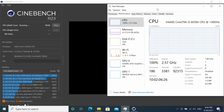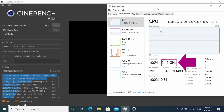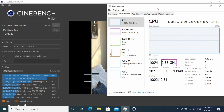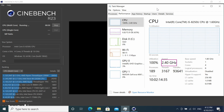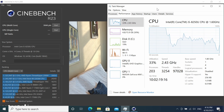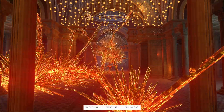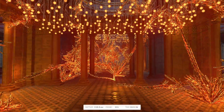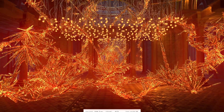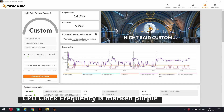Now, let's see how quickly my CPU can render the Cinebench scene when undervolted. Watch the clock speed to see if the undervolting hassle was worth it. 2.4 GHz for the whole duration of the rendering session — that's a massive 25% clock speed improvement completely free of charge. Let's also have a look at 3DMark, since its benchmark well imitates a real-world gaming workload. Undervolting improves gaming performance mainly in CPU-bound scenarios. While the 3DMark CPU test made the CPU throttle at 1.8 GHz almost the whole time at stock settings, it often boosts to over 3 GHz when undervolted.